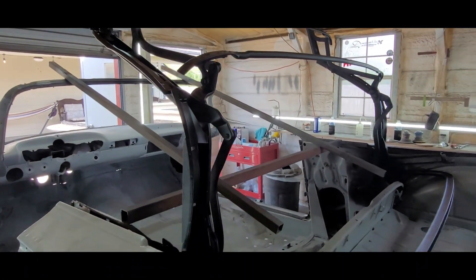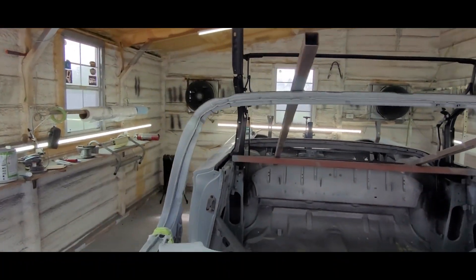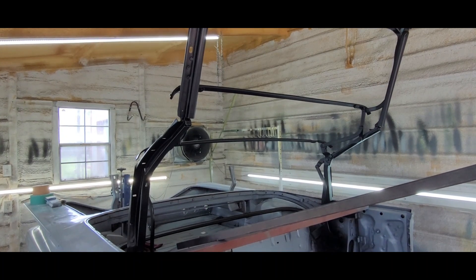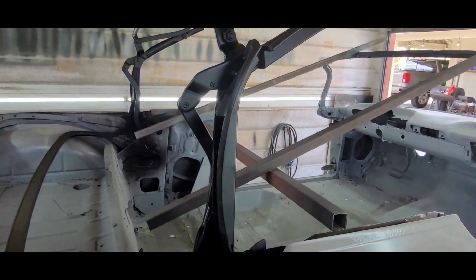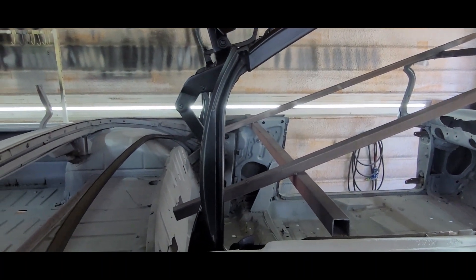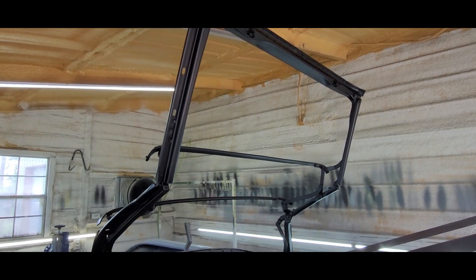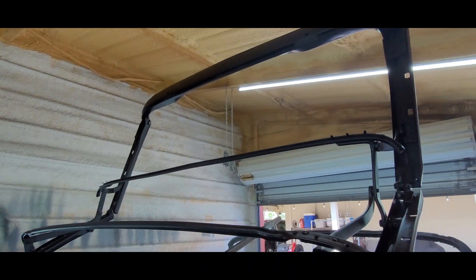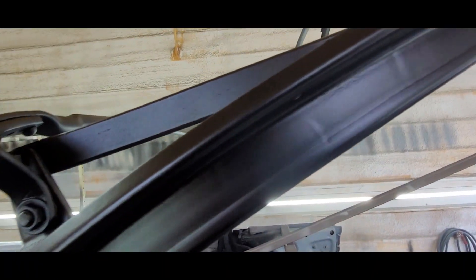It actually took a lot more paint than I thought it was going to take. I mixed up about 15 to 16 ounces total to get roughly two and a half to three coats. Overall it wasn't bad. It did get a lot of overspray — surprisingly I didn't cover the tail panel back here but got a little bit on there, not too bad. It's drying — still tacky — but that's matte black. I had to let the rack down to spray it, and then I put it down and was able to get the header bow. This paint covered 180 grit scratches relatively easily, and the header bow is 80 grit DA so it's pretty thick stuff.